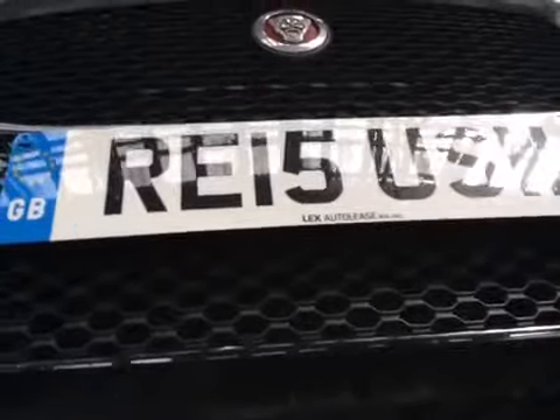Hello, my name is Ian and I'm carrying out a vehicle inspection on your vehicle. This is the passenger side front tyre — it's just below 5mm worth of tread. No signs of a foreign object inside the tyre. The front disc is in OK condition. Front brake pads are roughly about 10mm. The pads are in green, disc in green.